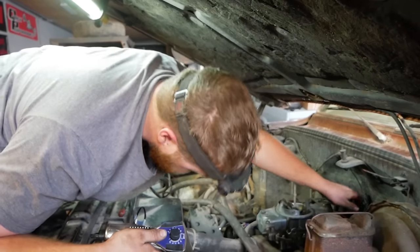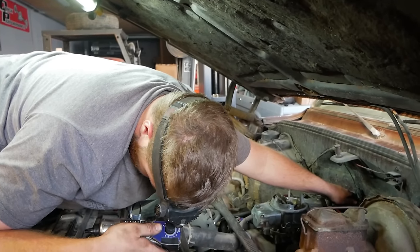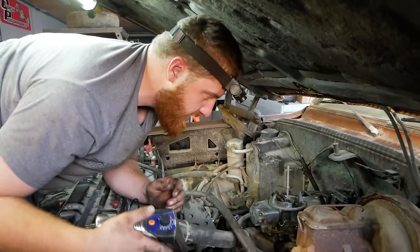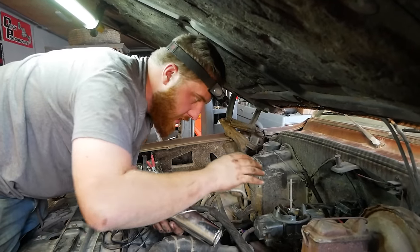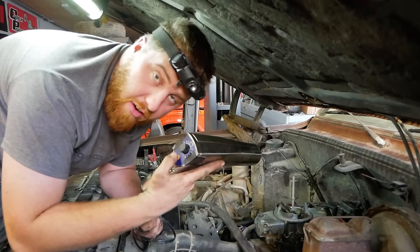The first three items on the list can be done in any order. Sometimes you want to start with your transfer slots, sometimes you want to start with your timing — it all depends on whether the car is running well enough. This one was not. When I started with timing I should have set my transfer slots first. Let's see if I can get it at about eight degrees. Okay, there's eight degrees and it's not running away — we're getting places.